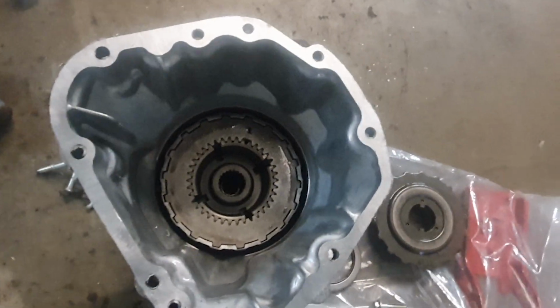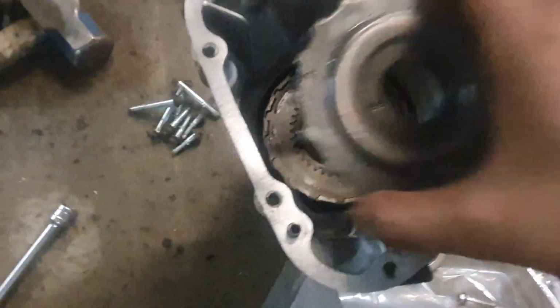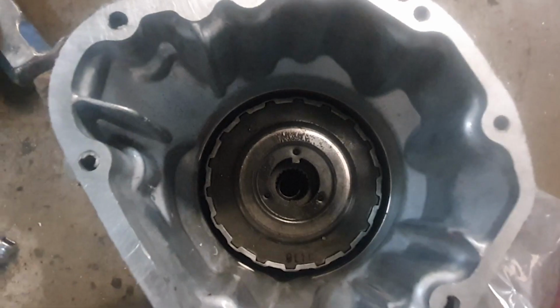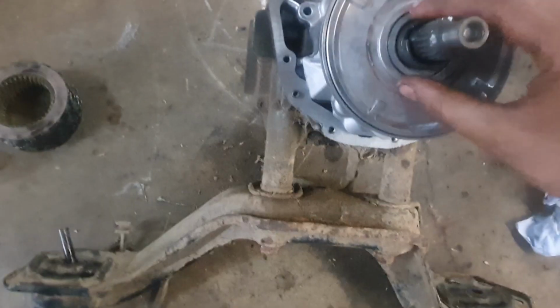Okay, so we've already put all the clutch locking plates in, smallest one at the bottom, and that OEM housing goes back on top. Make sure it's flush with the top of the basket. Firstly, the collar needs to come off. That has been completely binned, you don't need that. Right, pump off next, which is about 4 8mm bolts.